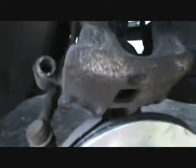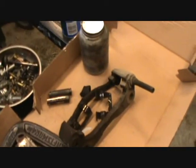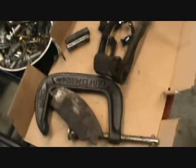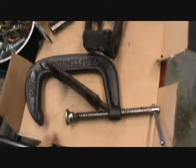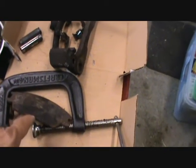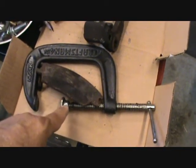So now I have to put that back together. The rotor is on and to push the caliper back — see the caliper piston? I have a caliper piston tool but it's designed for dual piston calipers, it's a little more cumbersome. The fastest way for me — at work I have a giant pair of channel lock pliers that are about 15 to 18 inches long so I can just grab onto it and squeeze it together. But here I use an old pad that's thin and an ordinary C-clamp — a 4 inch Craftsman C-clamp. I just put this up against the piston, put the back of the C-clamp against the back of the caliper, then run it up against the old pad and push the piston back with that.